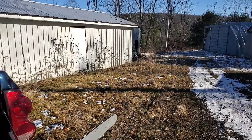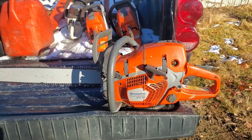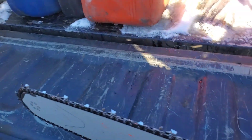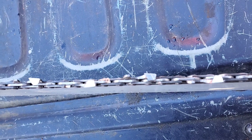There's my 572 XP right there. Now you see the tooth here — there's a line on the top of the tooth. Can you see that line? That's the angle you want to keep when you're filing, trying to maintain that angle of the tooth there.